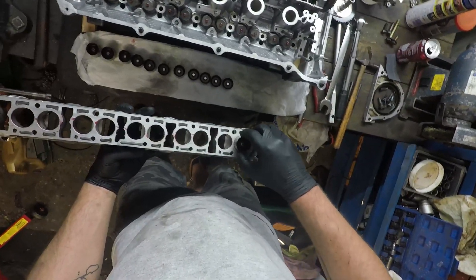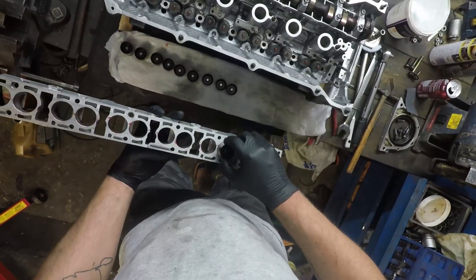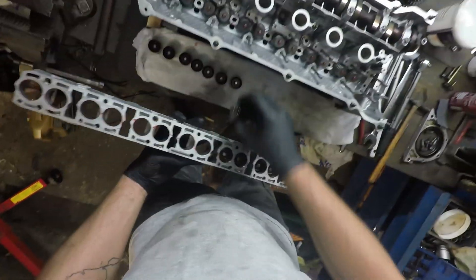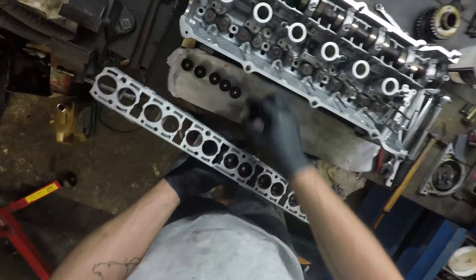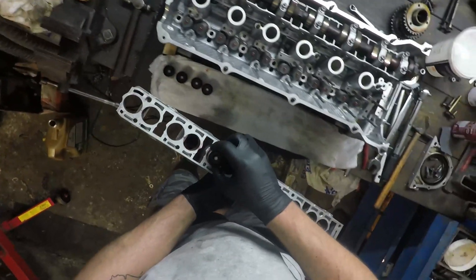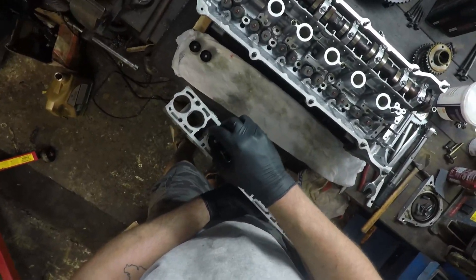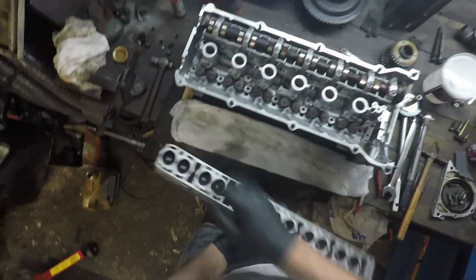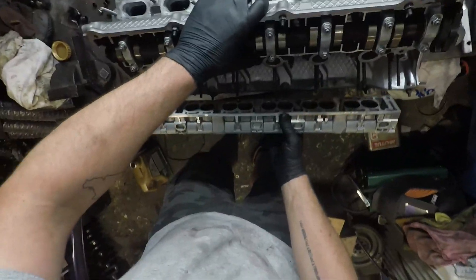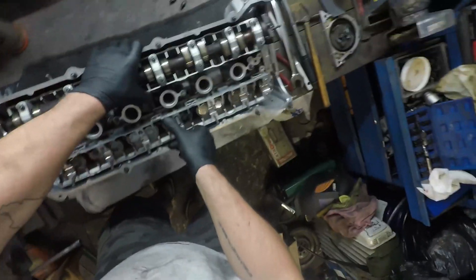I'm now putting each lifter into each cam tray slot, making sure the orientation of the tray is the right way around before I start, and just pushing them in and slotting them down. The assembly lube will hold them in there to some degree, but a tip I learned from Alberto Big Boost's videos: when he had the engine on a stand he rotated it so he wasn't putting lifters in vertically and having them fall out. So once the last two lifters are in, the easiest way is to lift the head and rotate it up towards me, putting the lifter tray on horizontally. As it slides onto the M7 studs the lifters stay exactly where you want them — easy as pie.